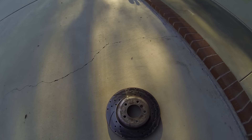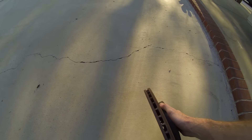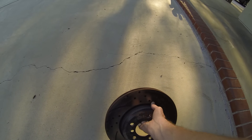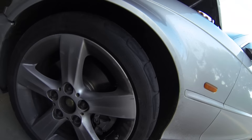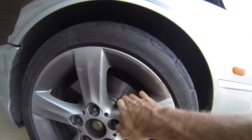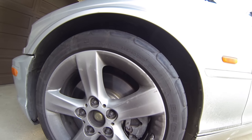So these rotors look cool, but they're not that great for track use. These are stock 330CI rotors — you can see how massive the brakes are on that car for such a light car. We're going to walk over to the new rotors I just threw on. They're from AutoZone, the cheap Duralast blanks. They hold up pretty well. These are the blank rotors — you can see I already started scrubbing in the pads. I have Hawk HT10 racing pads on here.